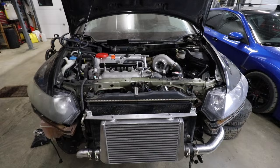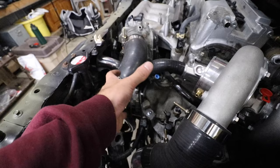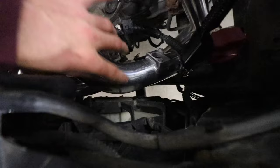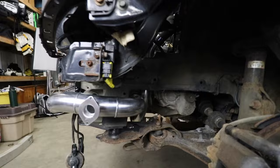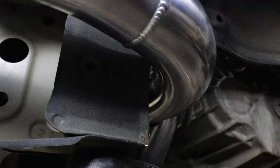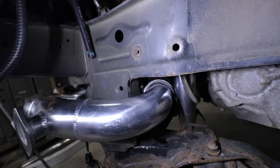She is almost looking like a turbo Honda - we've got all the intercooler piping installed and everything is 100% routed and we know it fits. This intercooler pipe coming off the throttle body - I had to angle it towards the front of the car - clears the lower rad hose, clears the rad fans, clears everything. Hopefully we can still fit the battery tray in there. In the time lapse you can see the frame now clears - I had to cut a pretty decent chunk out, but it definitely clears.